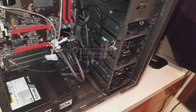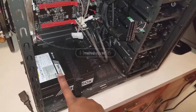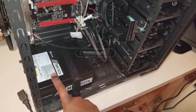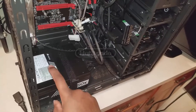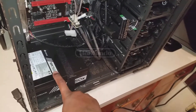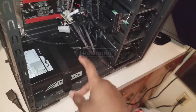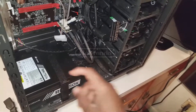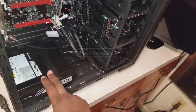What you need is to make sure at least one fan is connected to your power supply, because the power supply needs to be under load. If there are no peripherals connected, it's not going to read at its load and it's not going to turn on at all. So make sure one peripheral — it could be a hard drive or a fan — is connected to the power supply.